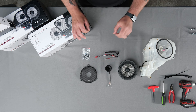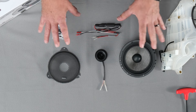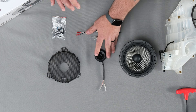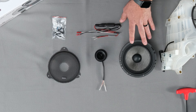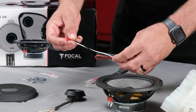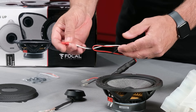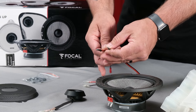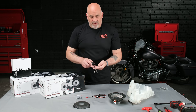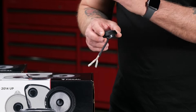Normally these are not plug-and-play, but we have now made them plug-and-play. With your kit you will get a new grille, the tweeter, the mid-bass driver, and the crossover. To make it plug-and-play, we've added an extension harness with the correct positive and negative terminals to go inside your pod on your Harley-Davidson. As for the tweeter, we've added some black shrink tubing so you cannot see the tweeter wire through the grille.